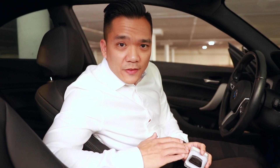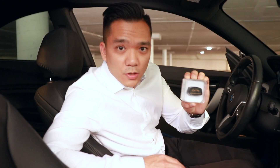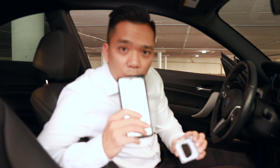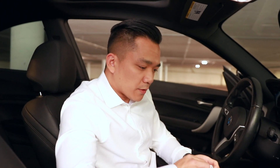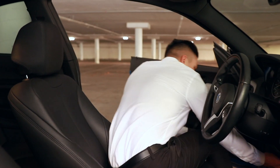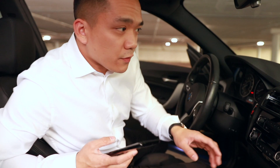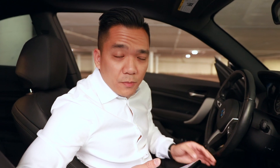You're never going to spend that much money, so we're going to keep cost low, and you really only need two things here. You're going to need this wireless OBD2 adapter, which I'll put in the link down below, and your phone. You're going to need an app called Bimmer Code in order to code the car so that it can properly reset the screen size. This whole process is about $100, and if you get the receiver on sale, it could be even less than that.